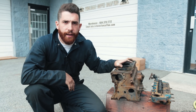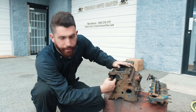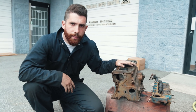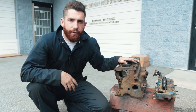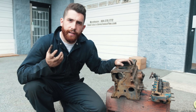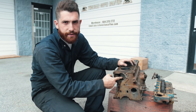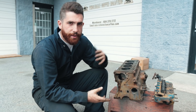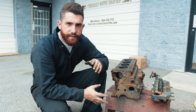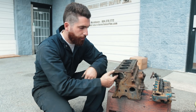One of the really important things about de-rusting an engine is not just for aesthetics, but actually for cooling — especially on these iron block engines. If they rust inside the coolant passageways, it can make an overheating issue that can't be solved with a bigger radiator or a better water pump. Rust is a much better thermal insulator than normal steel — something like 25 times more insulating. So if you have rust in the water jackets, your engine will essentially heat soak. The CLR has eaten away all the rust inside the water passageways, which is really important for a nice cool-running engine, especially if you're going to do a big bore with an aggressive cam running higher RPM — you really want to make sure it stays cold. Although aesthetically it looks great without rust, the really important part is inside the engine, which the CLR gets to.